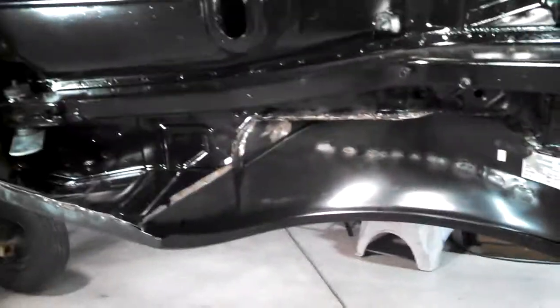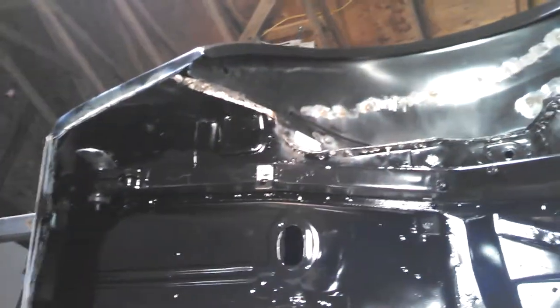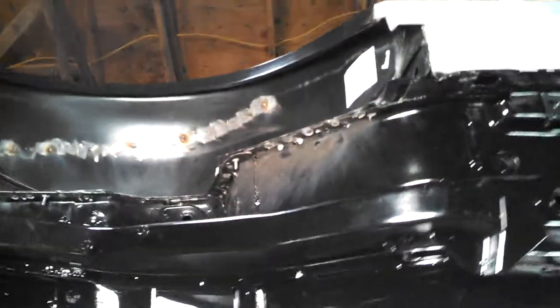Since I'll mix the paint up, I'll scuff it all up, prep it all, tape it all up, and I should be painting hopefully in 2-3 days. I'm going to work tomorrow grinding all these welds down, sanding them. If I have to skim coat them with some body filler or tiger hair just to make them look perfect.